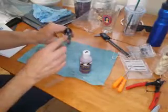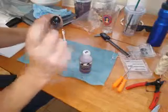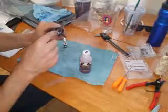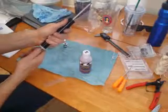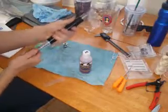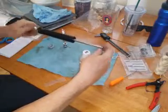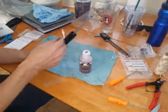Fill it not quite all the way — maybe about two thirds — and then slowly pump it until the oil gets on the other side of that middle slider piece that sits in the middle of the rods. That piece slides inside the tube, and you want to continue doing this until the rod is all the way to one end and when you pull it back there's no air bubble at all. You'll feel it — the pull will be stiff all the way through. As you fill it up and work the oil through, you'll feel an open spot like an air pocket, so you'll know there's still air in there. Also, make sure you're at the lowest setting possible on the damper adjustment, which would be number one.